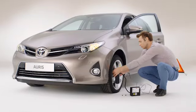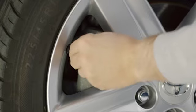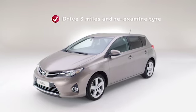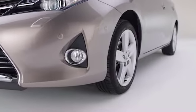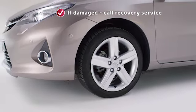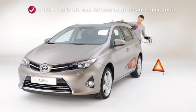If the pressure is okay, remove the sealant bottle from the valve and reinstall the valve cap. You then need to drive about 3 miles as the sealant spreads itself around and over the punctured area. Drive with caution because the tyre is not yet fully re-inflated. Then stop and re-examine the tyre. If it appears damaged, call a recovery service. If it remains inflated and looks okay, refit the kit and continue to inflate the tyre to the pressure listed in the owner's manual.